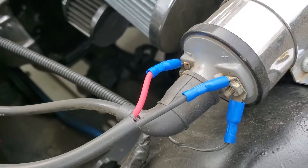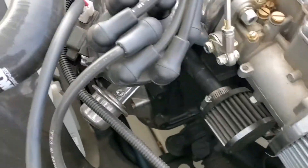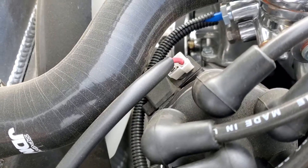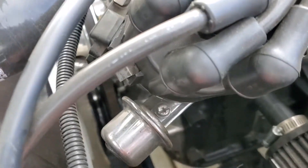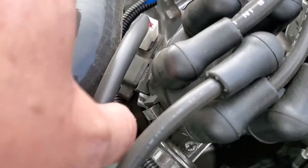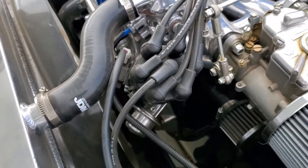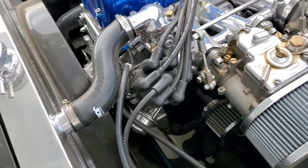Don't be confused by the wire colors — they're obviously opposite. The black one in this case is the positive and the red one is the negative. The top part of the T is the negative and the upright portion is the positive. This one here is the E1293 style, and that port just goes to nothing — it works just fine on this car. So you will connect your own two wires straight from the coil to the distributor, and you're all done.